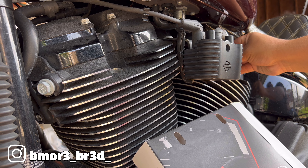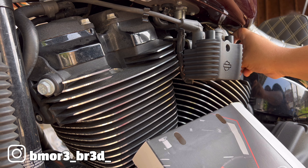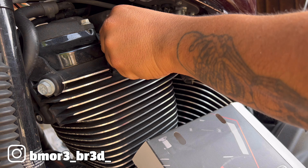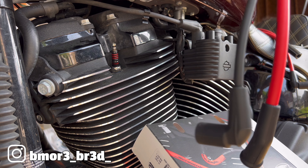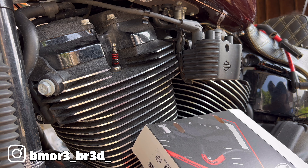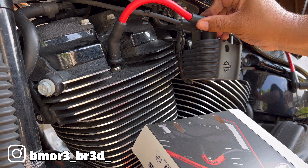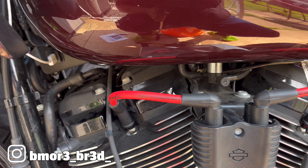Supposedly it's an upgrade but we'll see. When you put these in, do not crank down on them crazy - you don't need to, just snug them up. They do have the crush rings on there already. These are 10 millimeters for size reference. Using dielectric grease here - not too much, some on both ends, a little bit in there. You'll hear a click when it seats. Two out of four are on - they look real good.